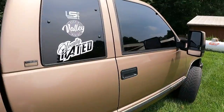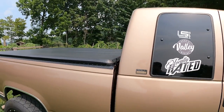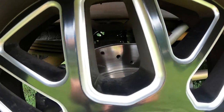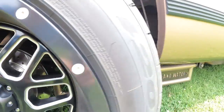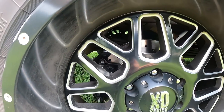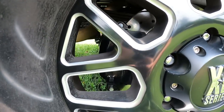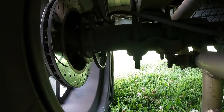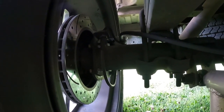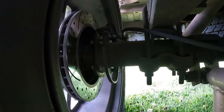In the rear I have LS MFG — they're actually out of near Nashville, Tennessee — and they have a rear disc swap for this truck. As you can see, I've got rear slotted disc rotors in the rear. The kit comes with everything. There is an optional upgrade I'll show you in a second that I highly recommend. It replaces the rear drums and is pretty much a bolt-on kit, though the instructions do call for grinding off a small tab when you remove the rotor.